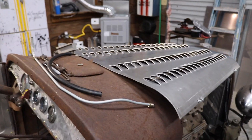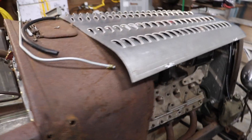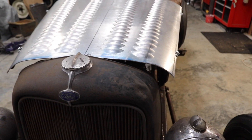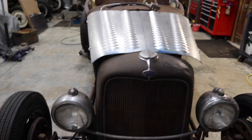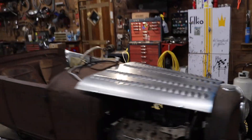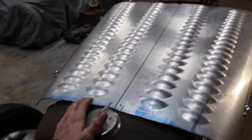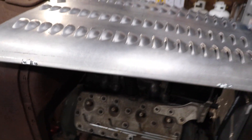So you can kind of see what happens when you punch the louvers — it's pulling the metal so much that this hood was basically fitting just right on the car without really pushing it down much, and now you can see how much it's flared out. So we'll need to add a little bit more shape back into the hood. I kind of want to throw it on my car to see what it looks like, because someday my car is going to have an aluminum hood on it. That's the exact same material this hood is made out of. I'm happy with the way the louvers came out — they're all pretty much nice and straight. There's a nice spot on the side of the hood where if he wants to write something, he'll be able to.